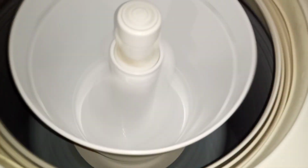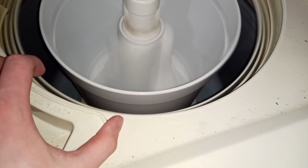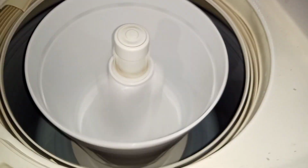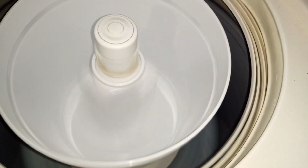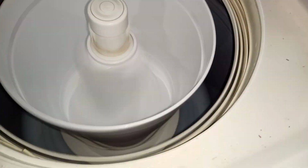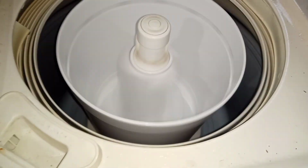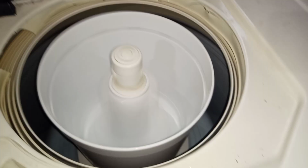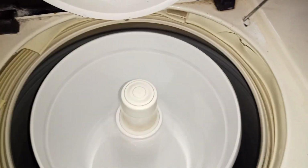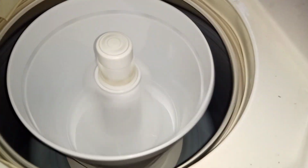For a mini basket, this is a pretty big thing. You know, the mini basket started out, you were only supposed to do 1 pound of clothes in it. Oh, jeez. You could fit two t-shirts at best. Well, the washer it came on was supposed to be able to do 12 pounds. It was a GE V12, they called it. Okay, yep. And it could do 1 to 12 pounds of laundry. And the water setting was mini, and then 4 to 6, and then 8 to 10, and then 10 to 12 pounds of laundry.